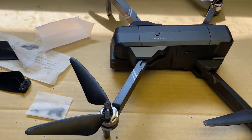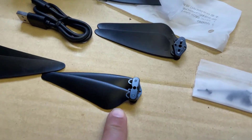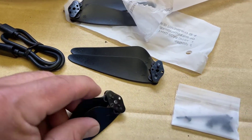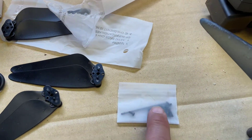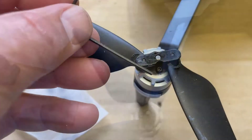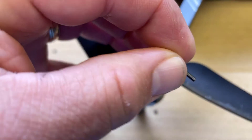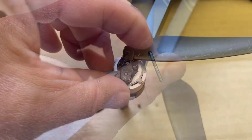After about six months, I'm gonna replace the blades on the F11 gimbal. Inside the pack, find the labels — they are either A or B. You can find them underneath the props, and there is also a wrench that helps you take them off. Do make sure when you're taking off the first one, you note where they're at. I'm gonna use the included allen wrench and take this one off.